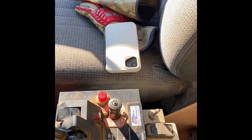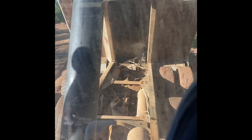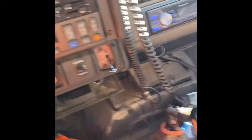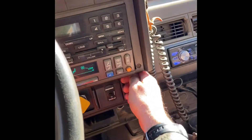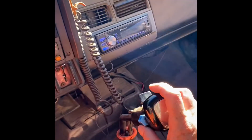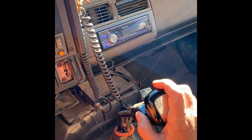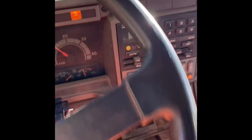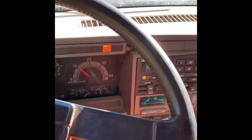Here I'm stuck after dumping — the truck won't pull out. So I go over, clutch in, neutral, flip up the differential lock — you'll see it right up on the dash. Put it in bull low, now put it in first gear — and it locks out like nothing.